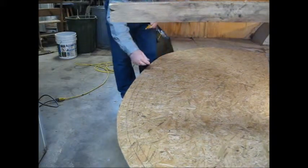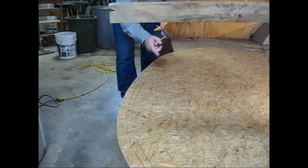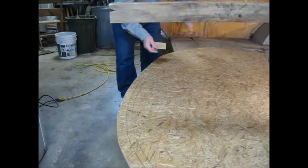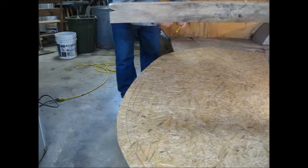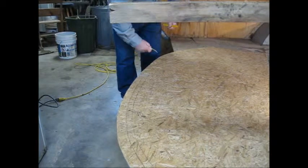Now I had to clip this over — this is the inside — because it's going to be too big to stand up inside the trailer and I didn't want to cut the bottom off of the panel to fit it in there. I kind of want it the same size as the outside skin. So I'll just mount it to the outside and then I can go on the inside and make sure my framing comes to this two and a half inch line.